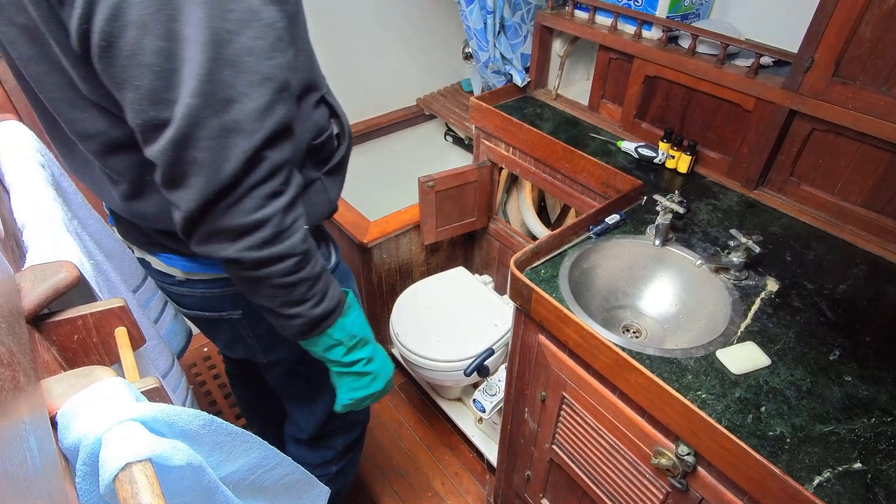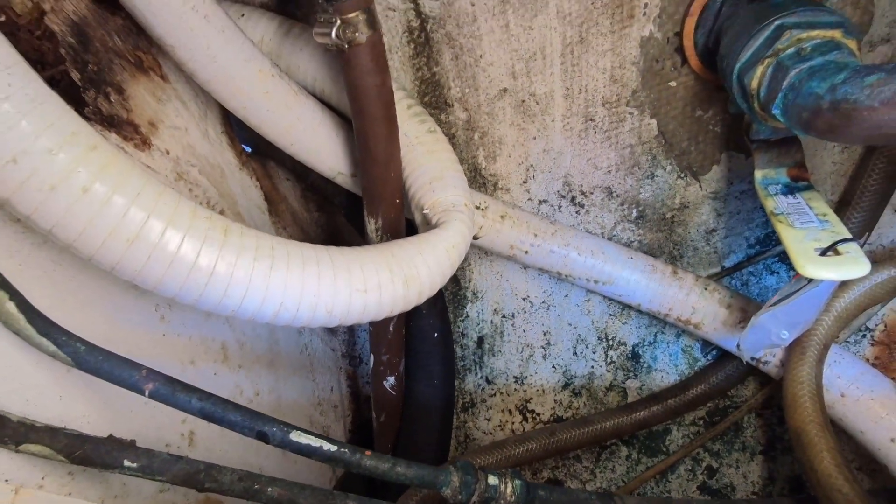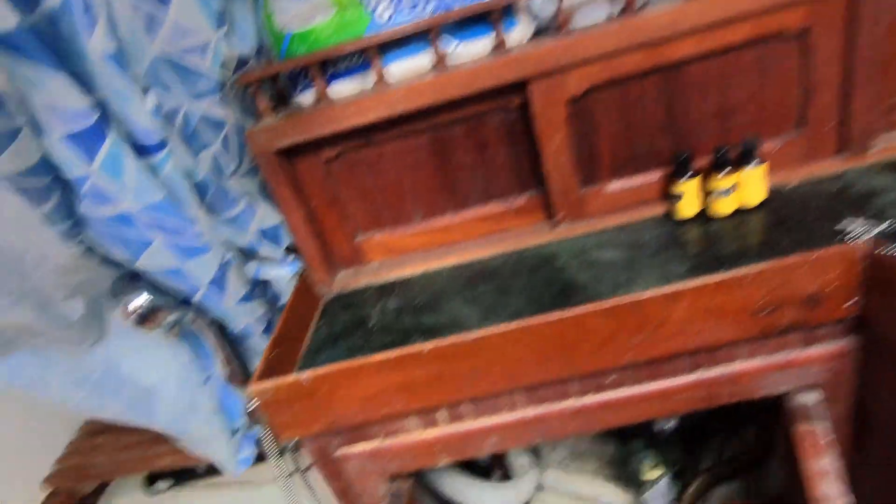Well, that didn't end up as horrible as I thought. I ended up being able to fix the toilet. It looks like there was a bunch of calcium buildup in some of the lines and there's actually a kink in one of the hoses. Right down there there's a kink, and I believe that was all filled up with calcium. I was able to unclog it and get the toilet working again. I still have the composting toilet on the way and that's perfectly fine — I still want to change it. I want to get rid of the hoses, holes in the boat, and the black water tank — the whole mess of it. I've already had several problems with the toilet and I've only been on here about a month and a half.